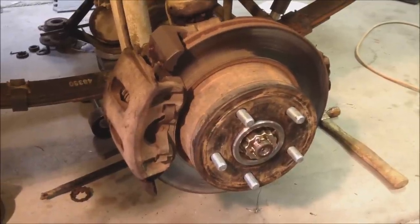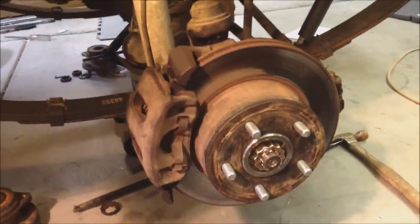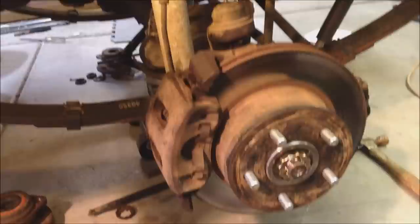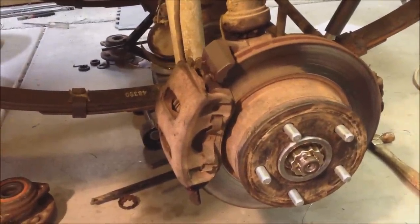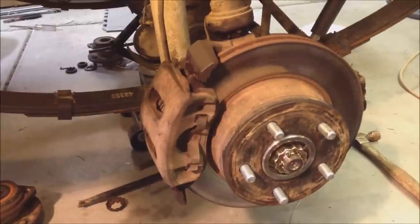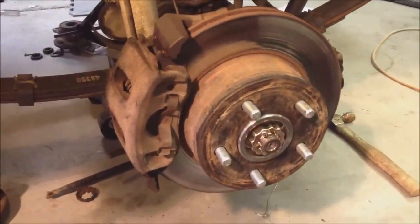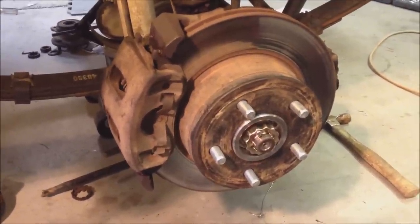And there's the finished product. All we have to do is put the wheels back on and torque the lug nuts. Because we've been messing with the brakes, we're going to check the master cylinder and make sure the fluid level is good. When we get in the Jeep and start her up, we'll probably have to pump the brakes a little bit to get them seated. So there you go — I hope this video helps you out. Check out some of my other Jeep solid axle videos.